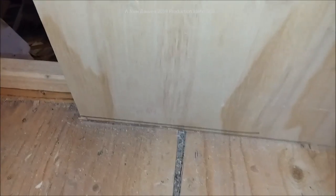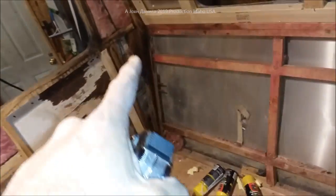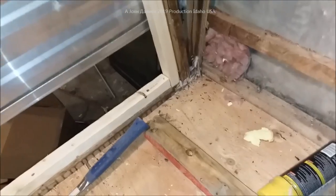But this allows me to get my distance all exact, so I can lay this board down and cut it once and slide it in, and it'll be snug, and then we will support and restructure this whole wall using 3/4 plywood, and then the regular paneling will go over it. It'll be the only area that's not super insulated, but the density of 3/4 plywood is pretty good for insulation too. And it'll also be fully insulated between that and the metal. And we'll repeat this process over here where we have a little bit of damage that the epoxy went into. So you can see down in there, there's the epoxy stuff, and it's strong now.